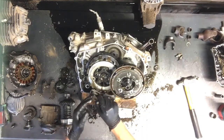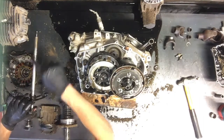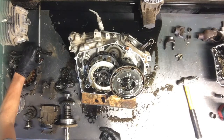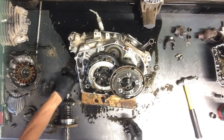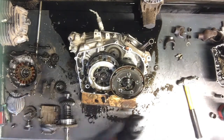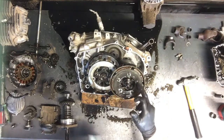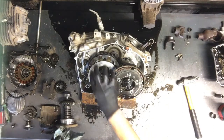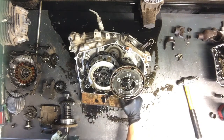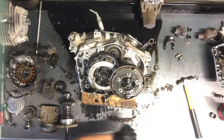There's the shift mechanism here being pushed on from the other side — it kind of popped everything off. Here's your shift shaft with splines on the end — that's a pretty common problem area. All these are shift components. For the clutch we have your centrifugal clutch here, your outer housing, and your shoes. The centrifugal clutch basket with friction plates and steel plates, clutch springs are here, and underneath this is the oil pump and a shift star down there.